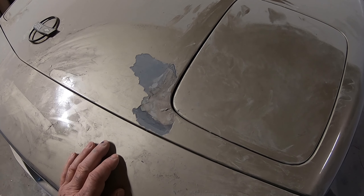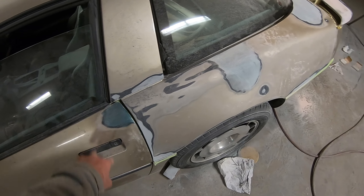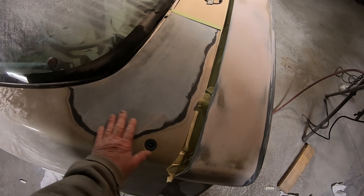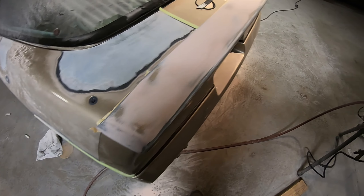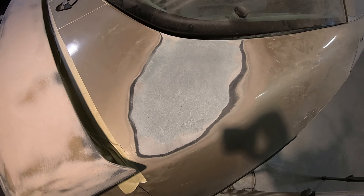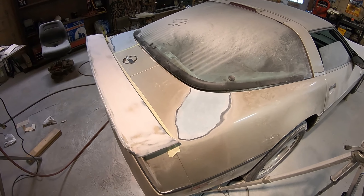But that's good for us. We'll get all these cracks fixed on the fiberglass, get filled in, over top with some dura glass. Just block it all down to 36, and we'll just let it sit for a couple weeks, let it cure. It'll be a lot better off — better than falling in later. We've got time, so we'll take it.